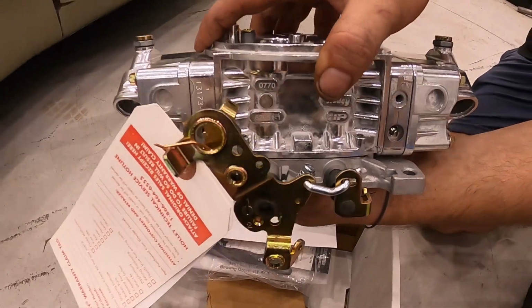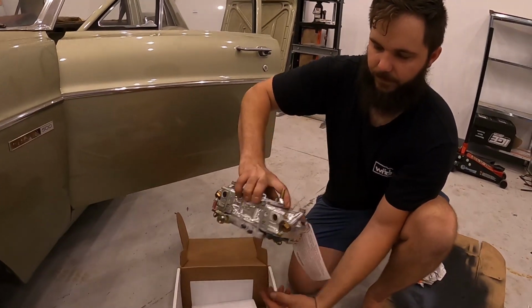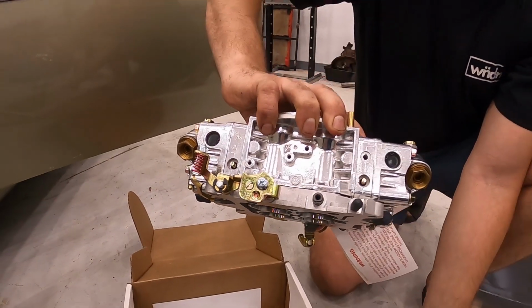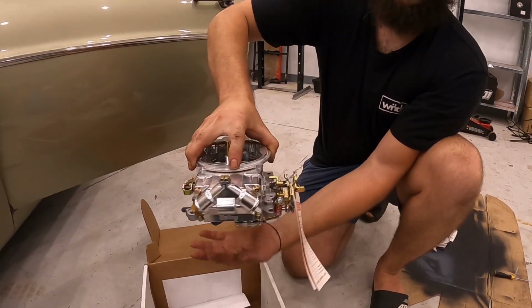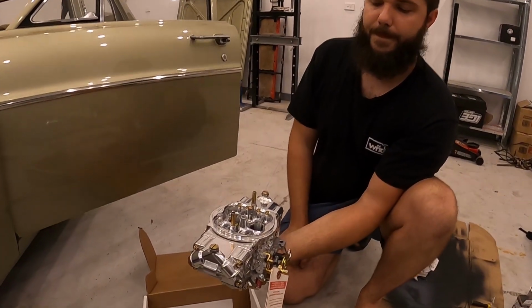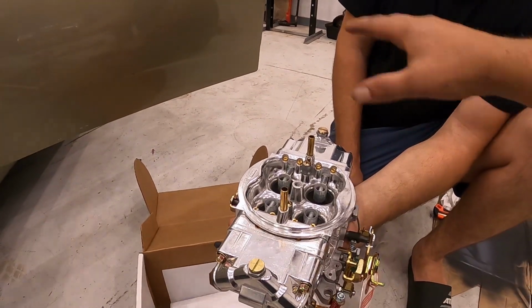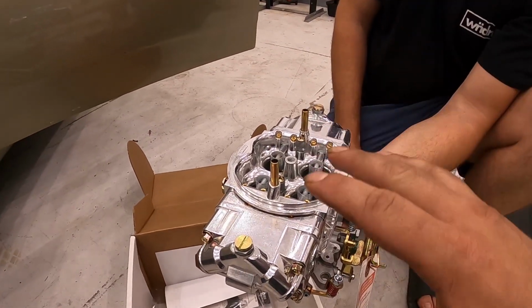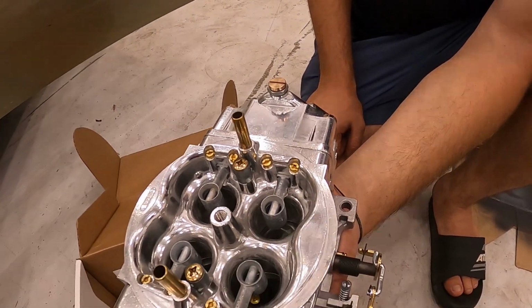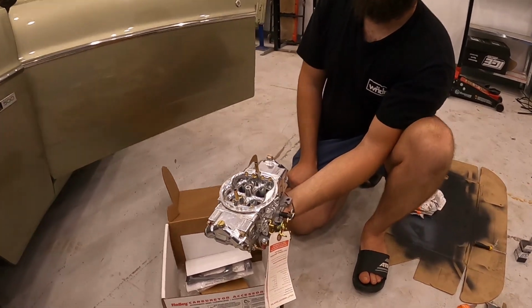The other thing you'll need, guys, is a twin feed fuel rail, which we have on the bench. Chrome fuel rail that's going to go into both of these bowls and hang forward. And the other thing you're going to need is a Wise air filter. Me and my brother are loving at the moment the Extreme Style 14-inch. The bigger the air filter, the better. Whatever engine you put a Carby on is basically an air pump, guys. You want as much air to get in with no restriction. Small air filters make no power.